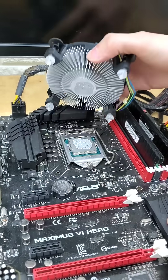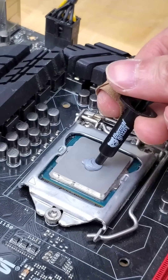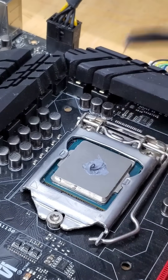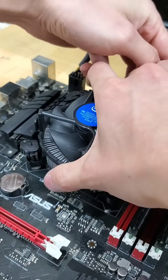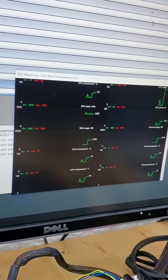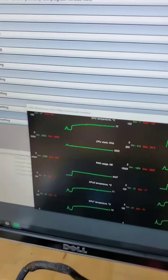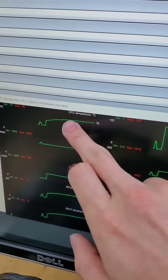Under the hood, we can see that this default thermal paste didn't spread all that much. So if we replace it with a higher-end thermal paste, using roughly the same amount, and add back our cleaned-off stock cooler — if we put the CPU under the exact same stress, not only do we see a more gradual increase of temperature, we also see it plateau around 5 degrees cooler than with the default thermal paste.